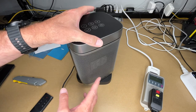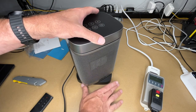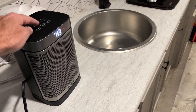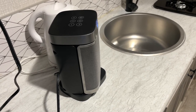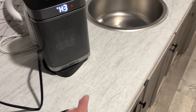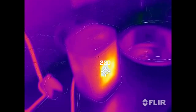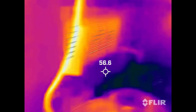I'm going to take this out to the camper, run it for a bit, and use my thermal camera to check how much the surrounding space heats up — particularly whether it's heating the countertop dangerously. Here in the camper with it running on high, using the thermal camera: the interior of the heater reads about 240 degrees, the countertop is at 61 degrees, the area further away is 50 degrees, the cord is about 70 degrees, and the plug is at 66 degrees.